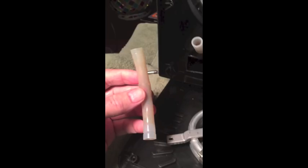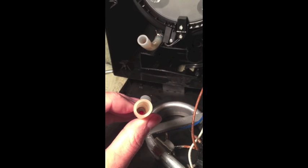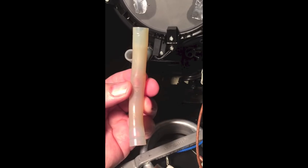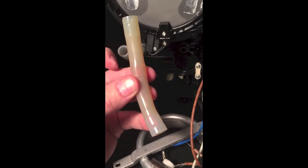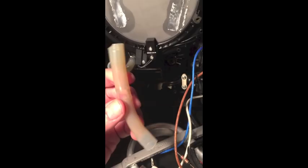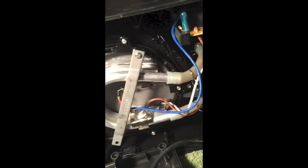We're back and I've got that really cleaned. I had a brush and put a little bit of soapy water in there and cleaned it out real good. The way to tell that this valve is working correctly is if you blow air in one end, you'll get a nice flow of air; if you reverse it and blow air the other way, you will not get any air going through — that tells you the valve is working properly. Shake it and you can hear that the ball is now loose and it's ready to reinstall.